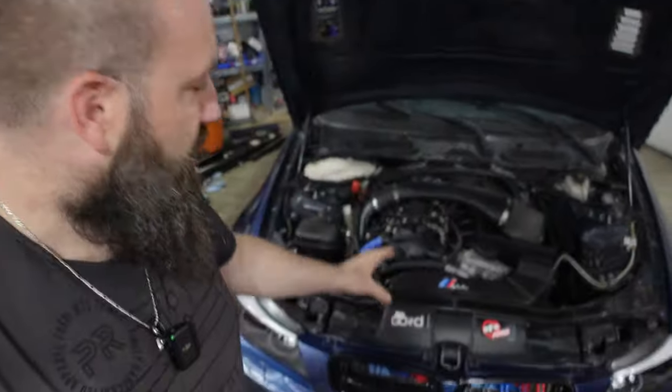Now where this ends up becoming my issue after changing all of this is that we started the vehicle, we ended up running it, we were going to fill the transmission, and as we filled the transmission, it randomly stalled. I'm like, okay, that's weird. So I tried to restart it, it was cranking, and I heard the fuel pump acting up, it was cycling, like the PWM was constantly strange, like it lost signal to the DME or CAS or something, which, hold on, you can pause the video and go get your popcorn because it's going to be an interesting little bit of information, but it stalled.